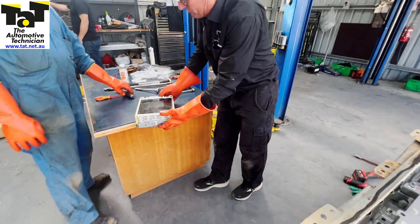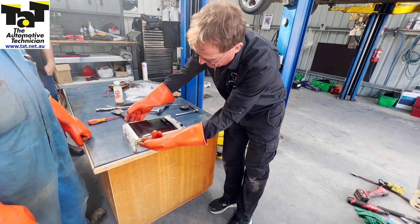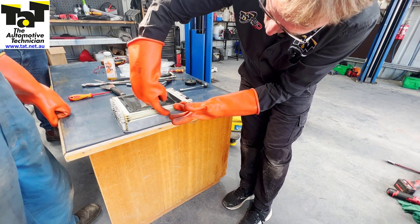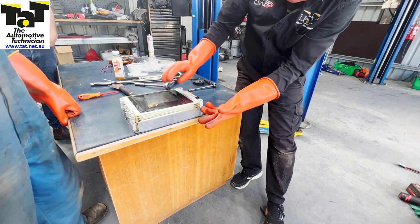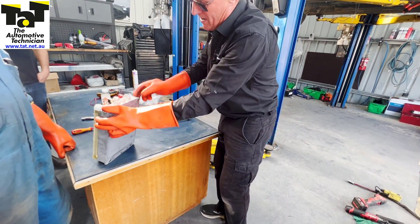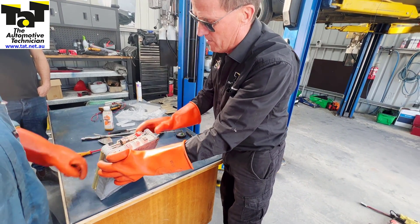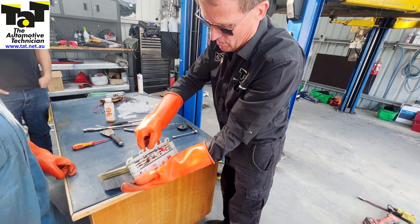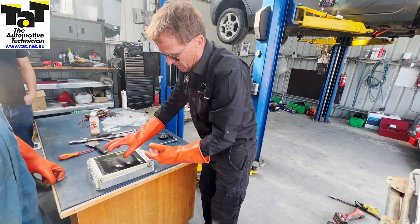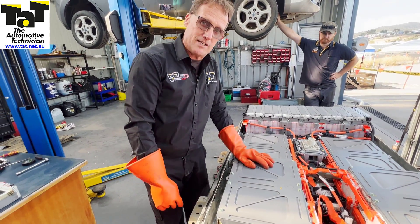You can see that we've pulled the battery apart. It's got the cells in there and they're called pouches. There's one pouch which is one sort of cell within the battery. There are four pouches per cell of the battery, and two cells in this particular case. The faulty one was the one at the very bottom here on the right-hand side. That's the internal design — what they call pouch cells within the battery packs — and that's the one we replaced. New one's in. We'll get this back in the car and then we'll do a final wrap-up.